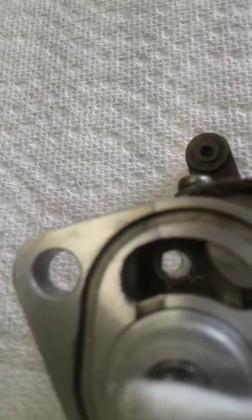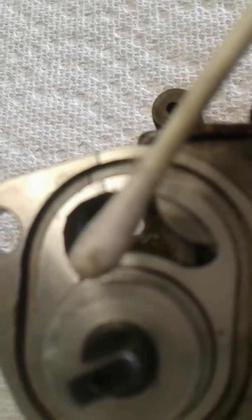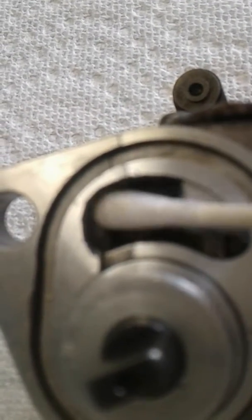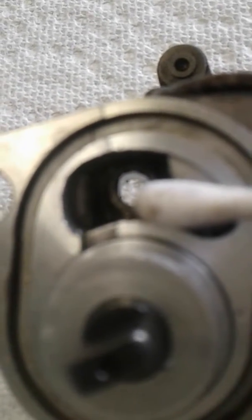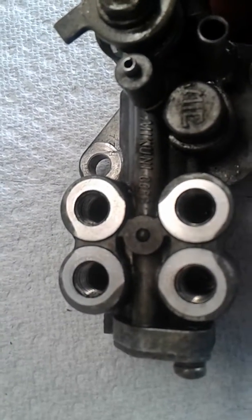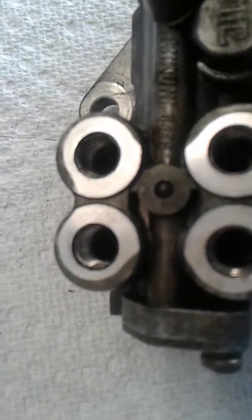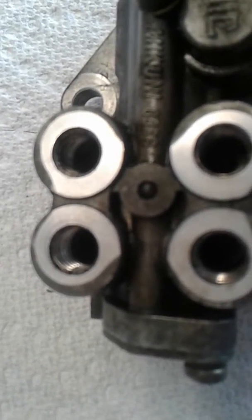Here is the shaft that turns the pump, and right here behind us is a little oil groove that the slinger throws the oil into, which goes into the reservoir right here. That reservoir pumps the fluid to these four openings, and each one goes to a different spot on the top of the motor to lubricate the rotors when they're under severe pressure — especially when you're winding up the high RPMs. This helps the rotors last.